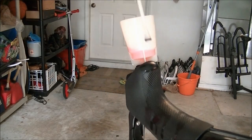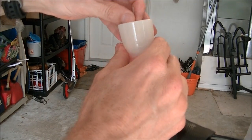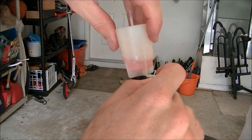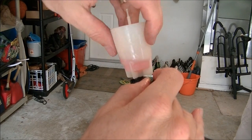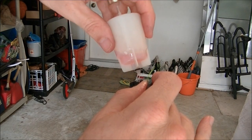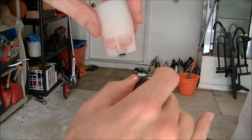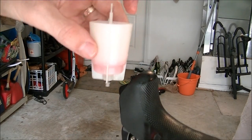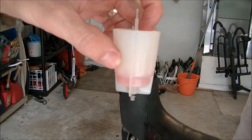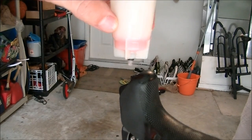Up at the funnel, put your plunger back in before you unscrew it — because if you don't, all your fluid is going to come out. It's not the end of the world if it does, but you want to be as neat as possible. Then dump the unused fluid back into the bottle by positioning the funnel over the bottle and taking out the plunger — this fluid is clean and can be reused.